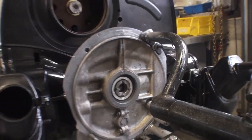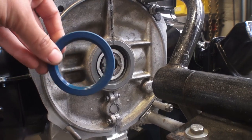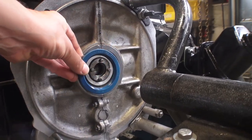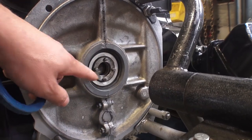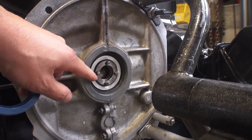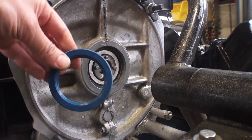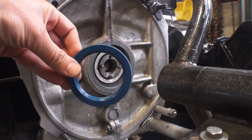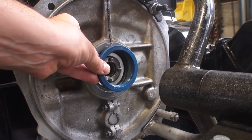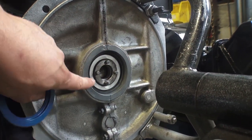As you can see here, we're rebuilding this motor here that's on this stand. We have not installed the rear main seal yet. This is your rear main seal, brand new one. This is where the end of the crank is. You have usually three shims that are around the crank — make sure you check your end play on that. You get a gasket that goes around the dowels here, and then you put your rear main seal on. They sell a tool that you can buy that makes this go in flush, or you can just get a start and use a rubber mallet and go all the way around and bang it in. It should be flush with the surface.